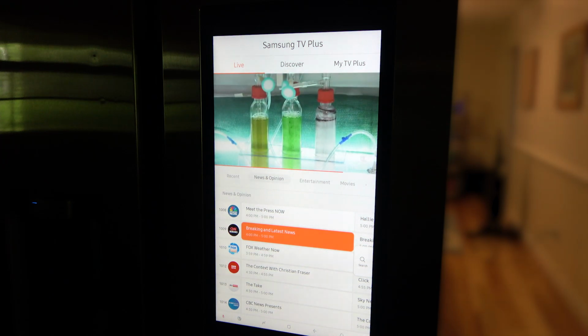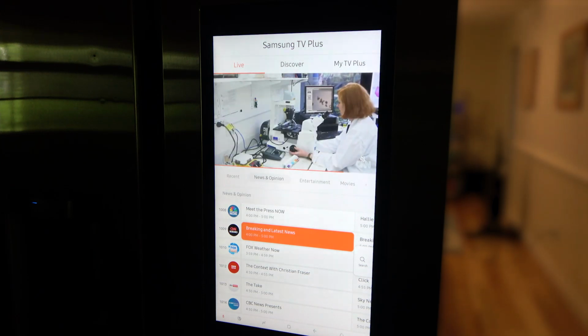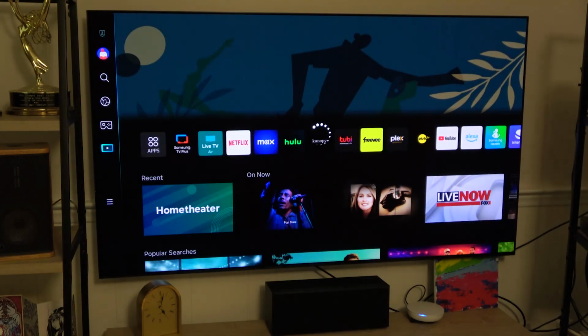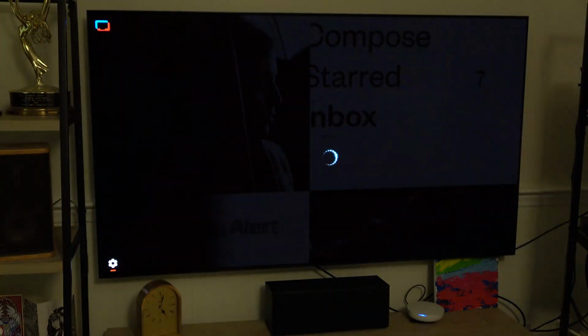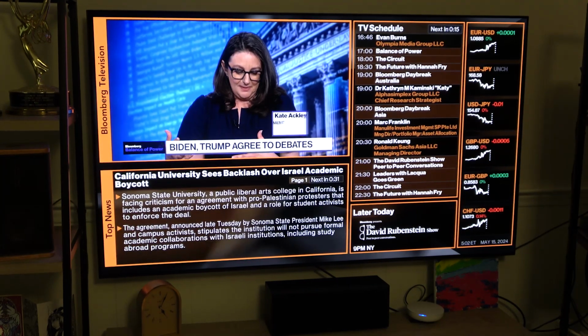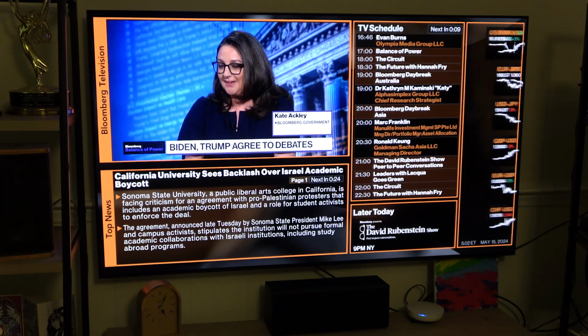This refrigerator connects via Wi-Fi, and as we see, the connection is made and we didn't have to program anything. That's because we repurposed the name from the old Uverse router. We switch on the TV, we go to Samsung TV Plus, which is all internet channels. As you can see, Ethernet and Wi-Fi are working flawlessly. So basically we kept all the settings from the Uverse, we just transferred them over to the Linksys, and all the devices think they're connecting to the AT&T because it's the same passwords and configurations. Saves you a lot of time from having to reconfigure all your devices.